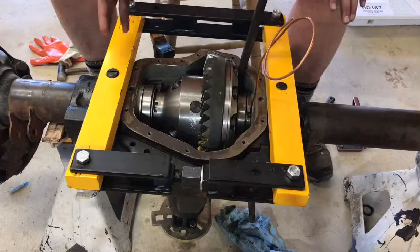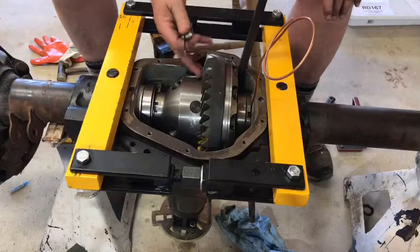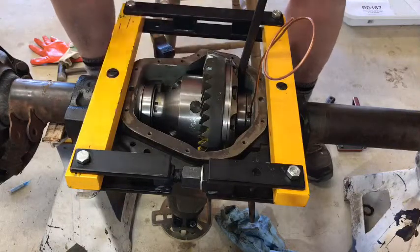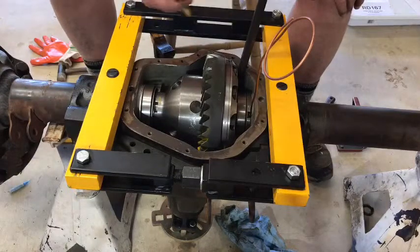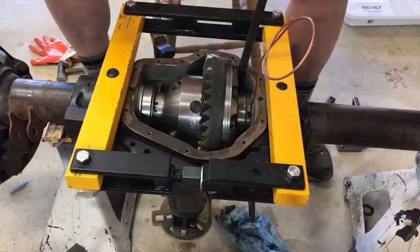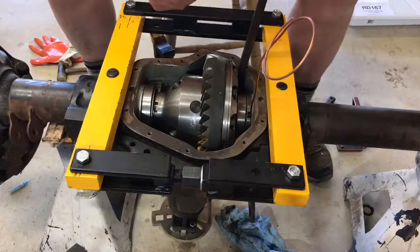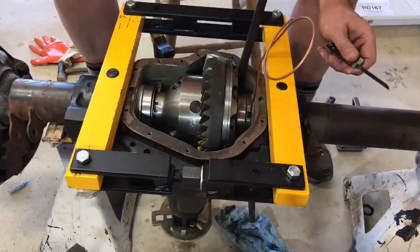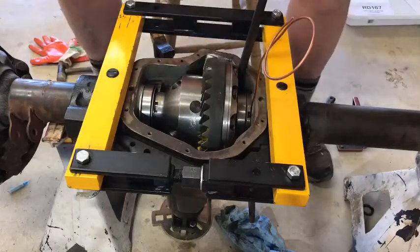That ought to really set my preload and ensure that my ring and pinion is running true and consistent with the gears. I'm going to do a final gear check, and if it looks good I'll do my final setup, which really only includes taking the back off, putting the final pinion bearing on, and buttoning it up. I've already installed the two little seals that go inside for the ARB. I'm hoping I don't have to take it out again, but if I do, I will.